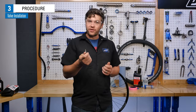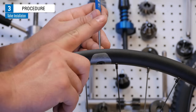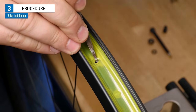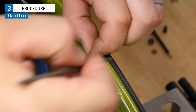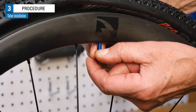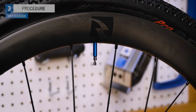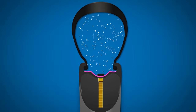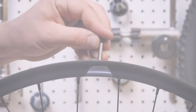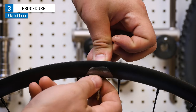Once you've installed the tape, it's time to install your valve. Use a pick to poke a hole in the middle of the valve hole. Do not hold your hand under the valve hole while poking. As an optional professional touch, you can use a small file to clean up the hole — a half-round file used for filing points or a small jeweler's file can be used. Now take your valve and push it through the hole you just made. Sometimes valves come with O-rings; these are to protect the rim from tiny scratches, not to make the valve airtight where it exits the rim. We highly recommend getting rid of the O-ring, as air pressure should be sealed inside the tire. If there is any leak in the rim tape, air can escape into the rim cavity where it is not designed to be, and there can be explosive results. Push down on the backside of the valve to seat it, then install the valve nut snugly — finger tight is just right.